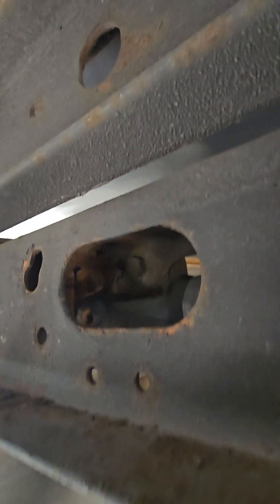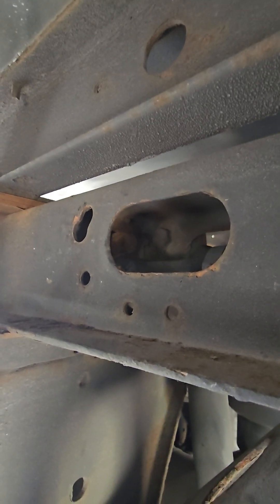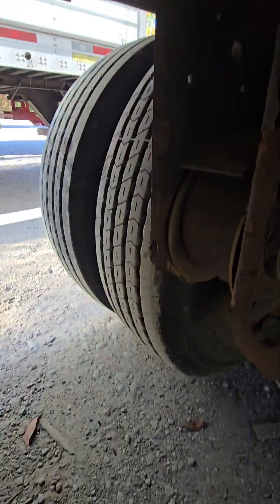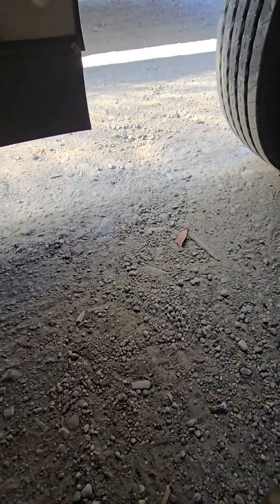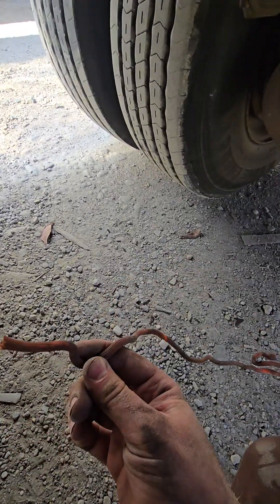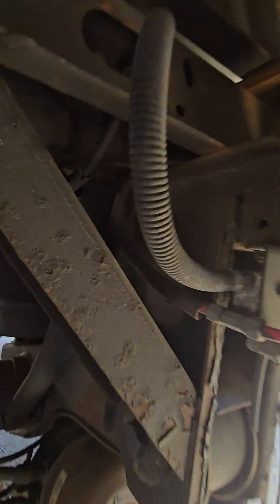The tracks go this way. Now there's a cotter pin that's supposed to go on it, but let's say I'm in the middle of nowhere and I don't have a cotter pin — so how would I fix it? A few things I have on hand: I found a screw and a bungee cord with a metal piece on it. I'm going to try to use something to wedge it in, just to give us enough to pull these springs.